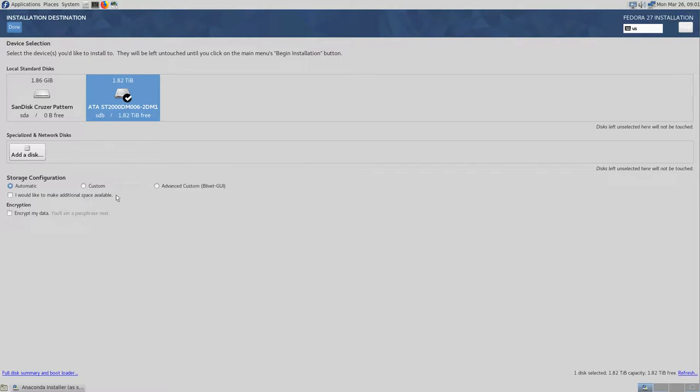You've got to be really careful if you're going to do a Windows dual boot system. By the way, if you're going to do a Windows and Linux dual boot system, you do need Windows already. The easiest way is to have Windows up and running good, and then use Partition Magic or something to resize your partitions. But they always recommend defragging your Windows system first, because Windows 7 will break if you resize it without defragging it. And sometimes it'll get messed up anyway.